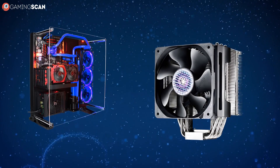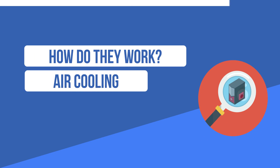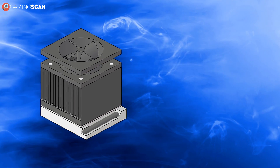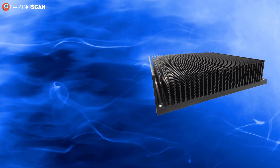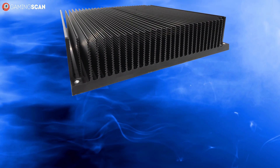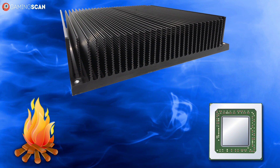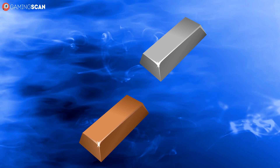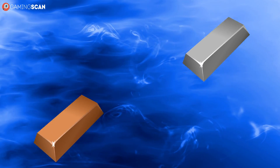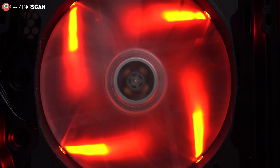Let's take a look at how these two cooling solutions operate, starting with air cooling. The way an air cooler works is really quite simple. It relies on two key components: the heat sink and the fan. The heat sink is there to draw heat away from the CPU, and it's made of highly thermoconductive materials — usually aluminum or a combination of aluminum and copper. But no matter how thermoconductive these materials are, there's only so much heat they can absorb. This is where the fans come into play. It spins to blow air into the heat sink and make sure it doesn't overheat.